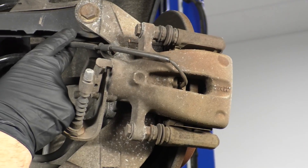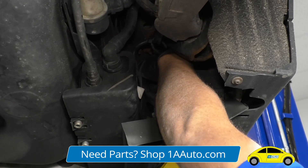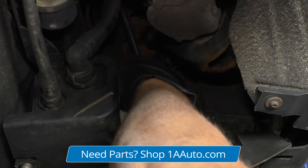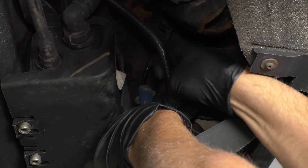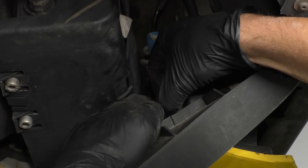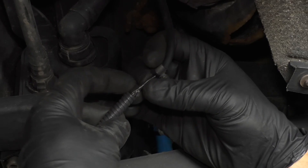So I'm going to look at the wire, just make sure the wire is not rubbing on anything. Check the routing of the wire — it looks pretty good. I don't see anything shorting out. I'll follow this wire all the way back to the connector — it happens to be the black connector in this vehicle. Just pull that out and disconnect the connector. Look inside there and see if you see any corrosion, anything green. It doesn't look too bad. Check the rest of the wiring harness and see if anything looks broken — it looks pretty good.